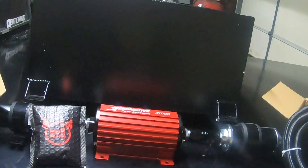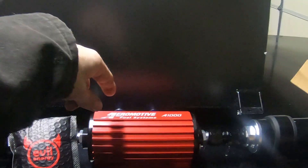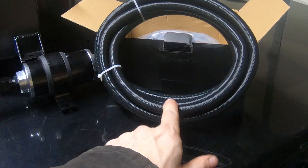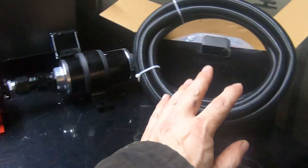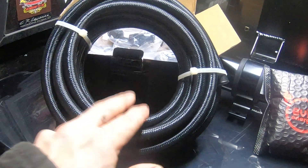What's going on everybody? Today we're going to be completely redoing Earl's fuel system. If you saw my post, I got that Aeromotive 1000. So this is what we got here — a 15 gallon fuel cell with 10 AN lines. These 10 AN feed lines are what's going to feed all this stuff, and then right here is 8 AN return.